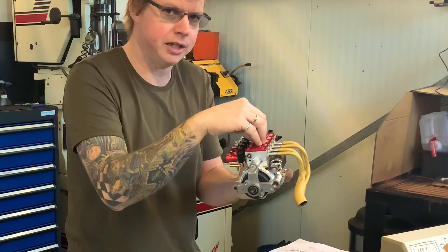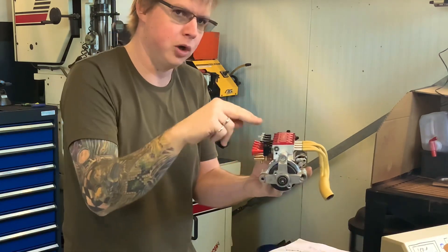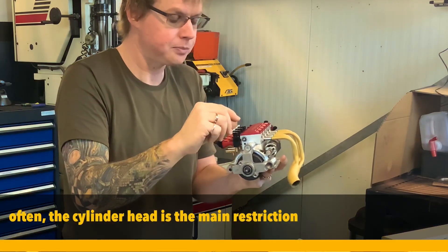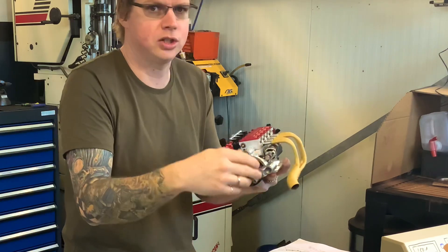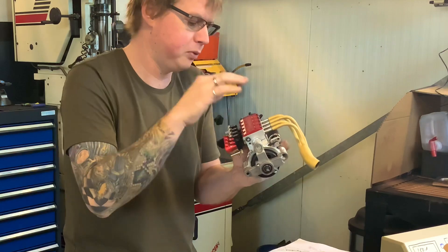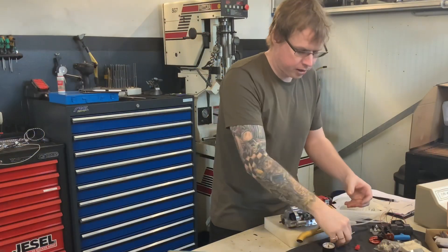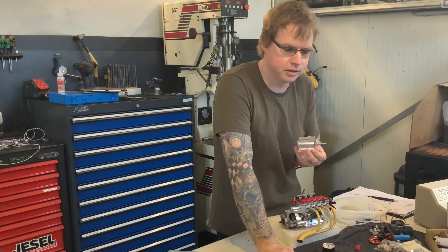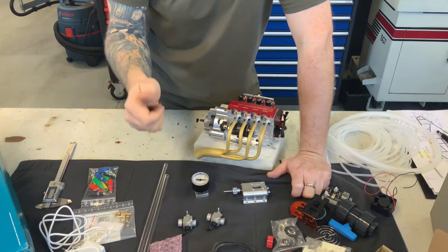I need something to measure this stock cylinder head. I'm going to modify it and then measure it again. So we do a stock measurement — you open the valves and measure how much airflow goes through the head at a defined valve lift. You want to achieve as much airflow as possible. An engine is an air pump, as most of you have heard. So we want to pump more air through this engine — if we get more air through, we can increase the amount of fuel and the engine's output. Additionally, my plans are to build superchargers for these engines, but I don't build anything just by estimating — we need real hard measurement data we can rely on.